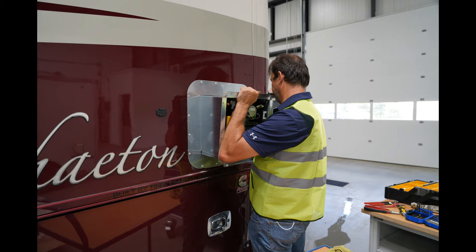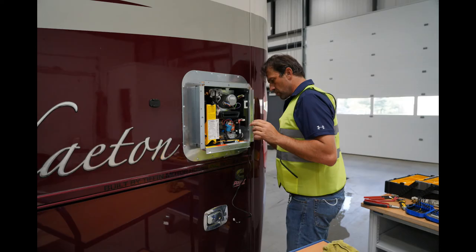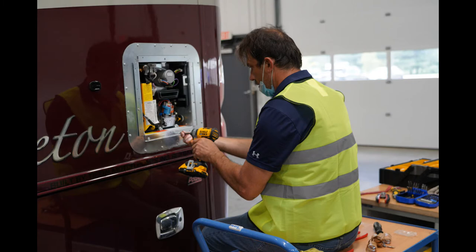And the biggest problem we had, after it was in, was getting the gas line to feed through that hole on the right. Truma does make a rear entrance kit to adapt it to a rear entrance fitting, but the tech really didn't want to use that, and eventually he was able with a pull wire to finagle the hose and get it through the grommet and get it hooked up. And there's a control that goes inside for this water heater. The wire for that also comes through that same grommet.